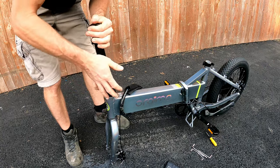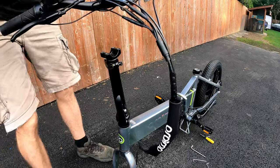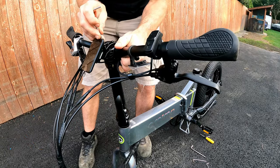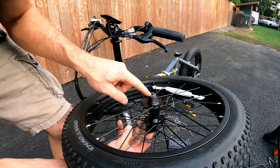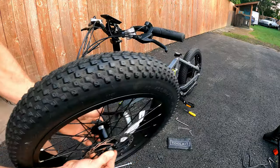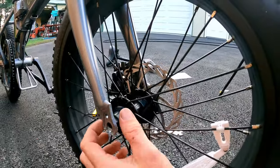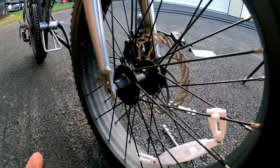It's a real portable bike. Use the 5mm allen to remove these bolts and the clamp, swing the bars, drop them into place. Make sure you have it oriented the right way and you're not jamming or twisting the cables. Drop the clamp back on but leave it loose for now. Drop the front wheel on, making sure you have even threads sticking out on both sides and the nuts aren't loose. Slide the disc in between the brake pads on the caliper and make sure it's fully seated into the forks.